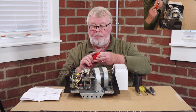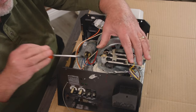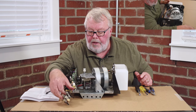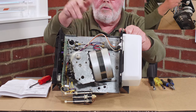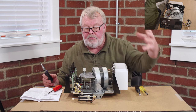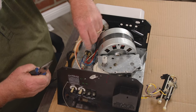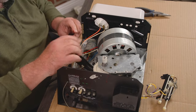So what we're going to start with here is we're first going to remove the limit switch assembly. That happens by unsnapping the limit switch from where it's held, and that can then just traverse out of the way — the wires are going to hold that. The next thing you're going to do is disconnect the wires connecting the motor to the various harnesses. We're going to remove those because this whole motor and assembly is actually going to lift out of here, so I'm going to start pulling the wiring couplings off. Now the wiring harness is completely free so that when we release the motor we'll be able to take this right apart.